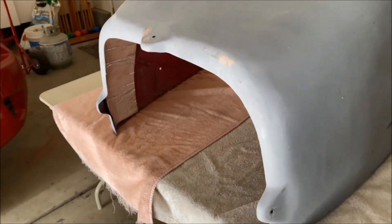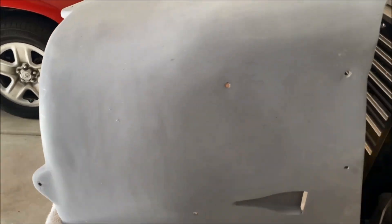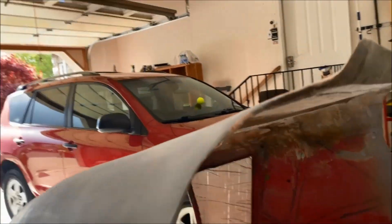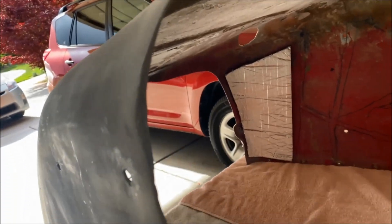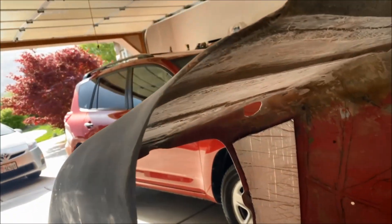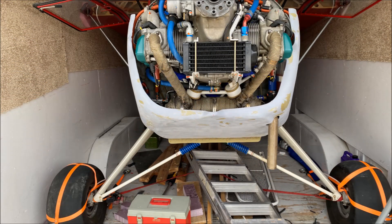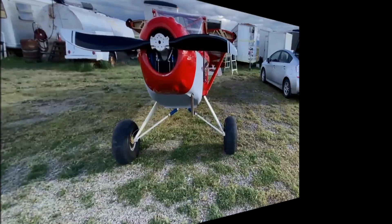As you can see, there's no air intake on the cowling on the bottom — it's just all covered, and there's no need for one. I was waiting for summer to fly in hot weather. I've flown in 95-degree weather and my engine temperatures are pretty good — no noticeable difference between before and after the cowling was covered.